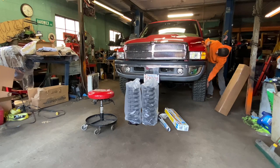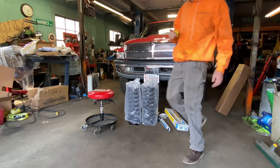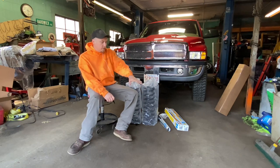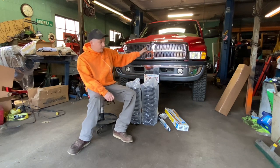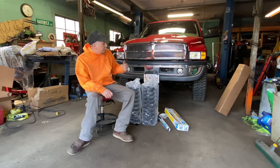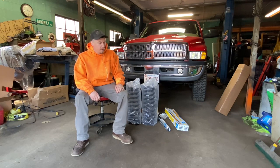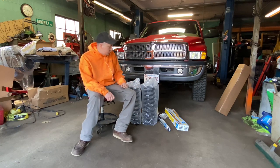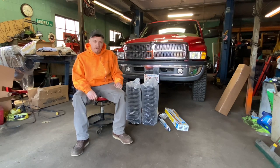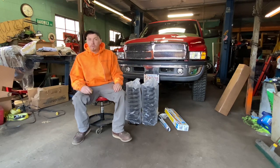From tar to fender we're 40 inches — remember that. So we're 40 inches from the concrete to the top center of the front fender. That's what we'll do today: get this thing leveled out, the little typical stock Dodge rake gone, new shocks, new coil springs. These trucks look way better with a little height in the front. Without further ado, let's get to it.